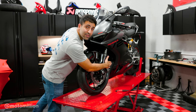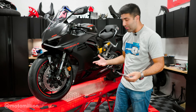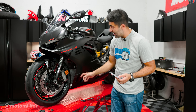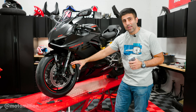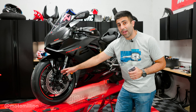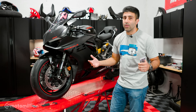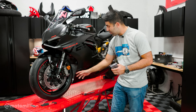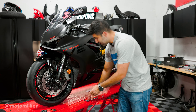Now that we're in the front, let's get rid of the dreaded reflectors off of our calipers. We have caliper spacers, and the stock reflector acts as a spacer. You might be wondering why the caliper spacer sits on top of the calipers — the only explanation is that the reflector has to mount somehow and they used a spacer-type piece. We're also going to be changing our brakes. If you upsize your brakes, you can move the caliper spacers to the bottom and run Panigale V4 spec rotors, which is a bigger rotor. For street use it probably won't make much difference, but if you track it or are an extreme street rider, you'll benefit from the larger rotors.